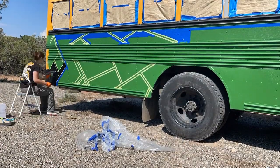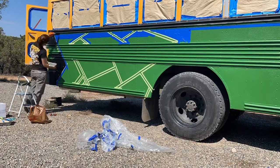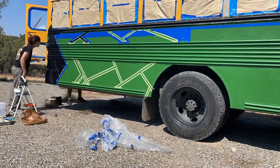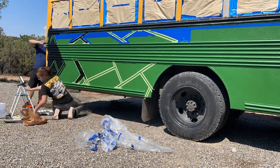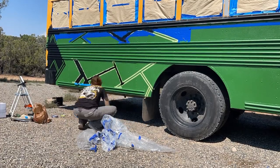This helps get the sharpest possible line. I went through and re-scuffed everywhere that was going to be black and re-MEK'd it. I just want to reiterate that for you — you need to do that if you want it to adhere properly. Then as soon as I got my second coat on, I pulled my tape.